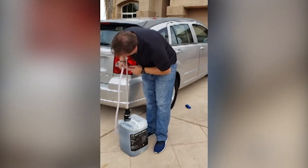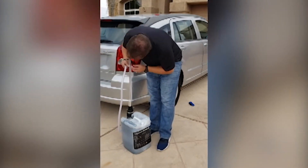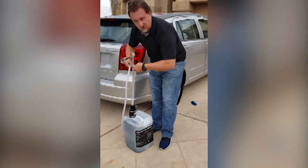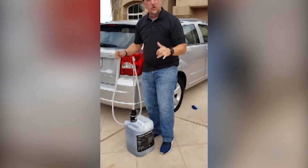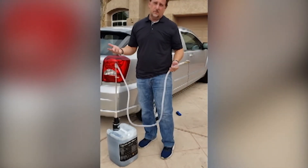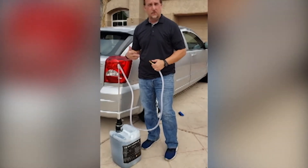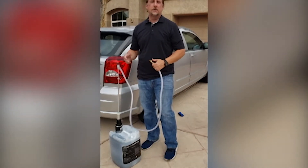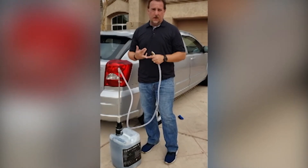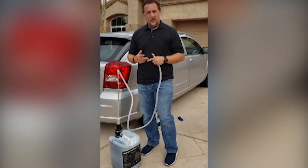The top line is eight ounces. Make sure the bottom of the washer sits at the top of the line, and get it good and tight — you don't want too much or too little. Too little and it doesn't perform as well; too much and it'll create a balance issue. The nice part is if you do put in too much, you can simply wipe it out — the product is water soluble, made with recycled rubber and Kevlar.